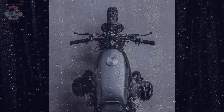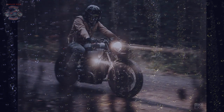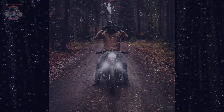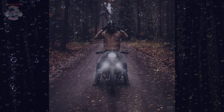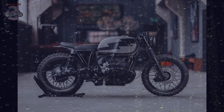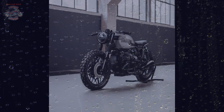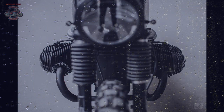With the space under the seat left bare, Huka constructed an abbreviated subframe from steel tubing. It's propped up by a new pair of YSS shocks, and capped off with an Alcantara-clad saddle that's just big enough for 2, or 1 plus luggage. There's an LED tail light embedded into the back of the seat, and a neat little aluminum fender mounted straight to the subframe. Up front, Huka have dropped the front forks by just under 1/2 inch, then tuned them for more compression. Brackets were fabricated for a new headlight and turn signals.